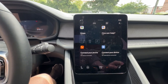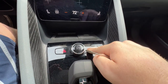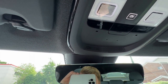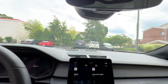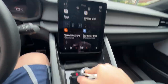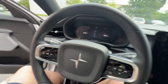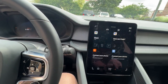Things you can troubleshoot with: if you're on a later software update, try pressing and holding your defroster for about 20 seconds until you see the SOS light change. That is supposed to reset the telecommunications module and hopefully get you back online. You can also try pressing and holding the play button, powering off the vehicle, getting out, shutting the doors, and locking the car for a while before you come back.